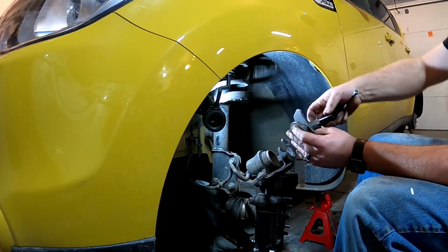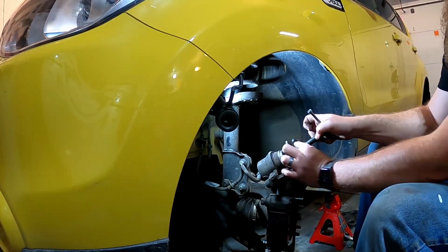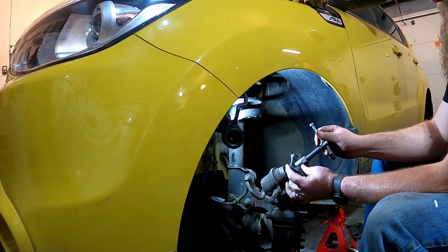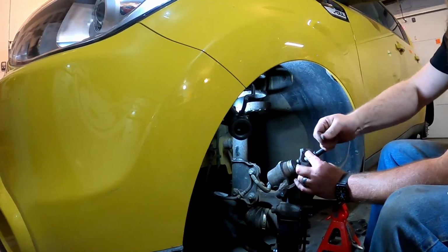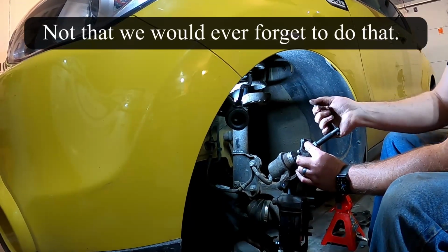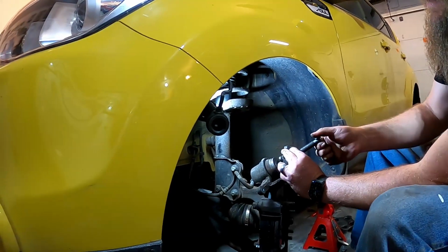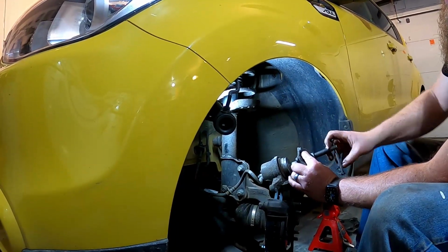So this one, I just screw this down nice and tight. You screw this on down a ways, set that on the outside there, line up my cap on the outside of that piston. I'll just hold this with my hand for now and then turn the handle. What I'm doing then is those threads are taking this brace right here and just holding that up against the outside of the piston. And now I can just turn with my hand. If this does not turn easily with your hand, you may have a frozen piston. Maybe you forgot to open up your master cylinder there. I'll hold this sometimes with my hand, sometimes it'll just stay by itself. And I'm just easily threading that in, and as you can see here, that piston is pushing right on in.